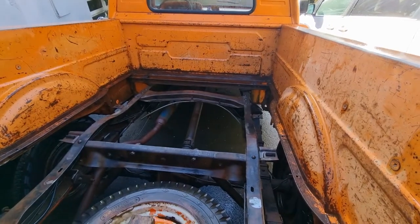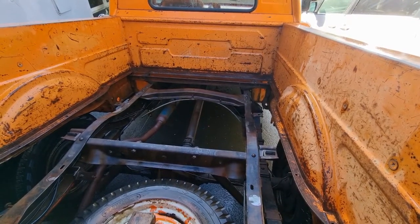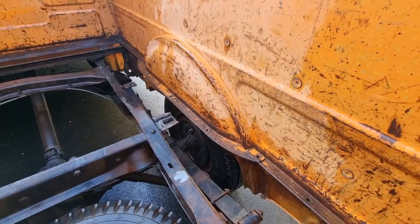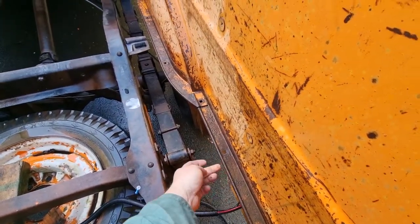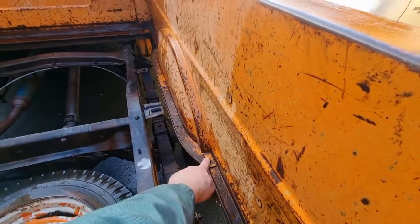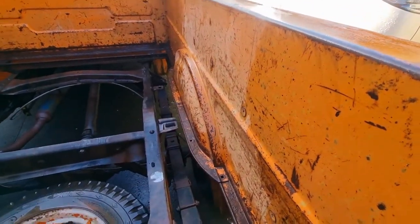So it's going to dry off now, and I think I'm going to put the first bit of wood in today and mark out these wheel arches I need to cut, because the wood slides right up to about there, that far in, so it's up to the main bit of the body. So I'm gonna have to cut out about, what's that, 2.5 inch out.